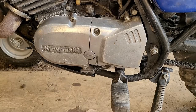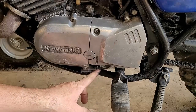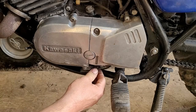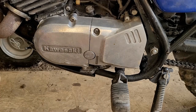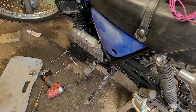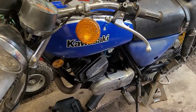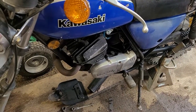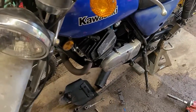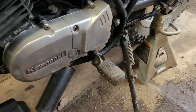The next step is to get the clutch all set up. In order to do that we have to remove the bottom inspection pan because this clutch mechanism right here doesn't give us much room to work with. I need to get the proper tools and take off that bolt — the motor mount bolt and the two screws underneath. We just had a massive storm come through — it's crazy. I did a couple of things off camera and I'm going to show you what they are, because some of the technical stuff I can't show in its natural habitat — I'll show it outside the bike.